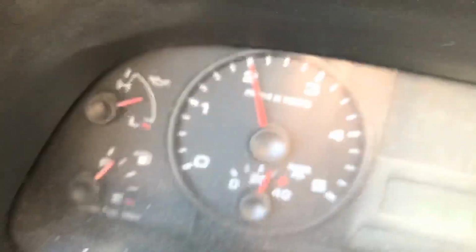Yeah, 6 is shot. You hammer into the pedal, and I don't know about boost, though. Even though it's got a cracked CAC tube, it's seeming all right considering that number 6 is so bad. You bring that number 6 back, this whole truck will change. I wouldn't worry about boost right now. You're good. It's hitting 28 pounds. And it's not shifting funny. It's not taking power away.